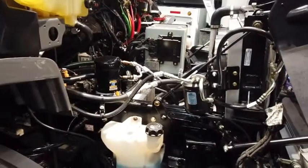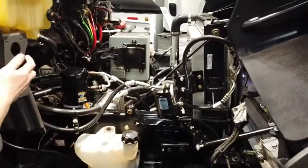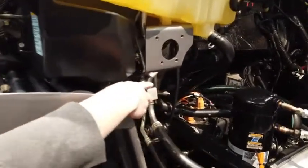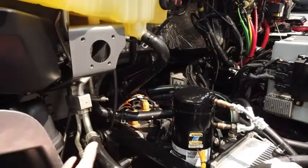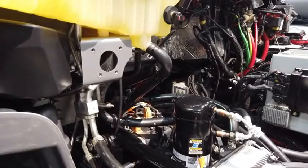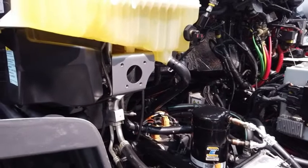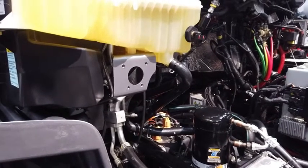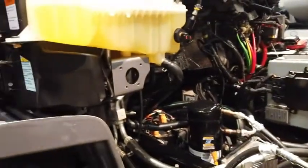It handles things like your AC unit when it kicks on and different things like that. To the back of the truck, that silver box with the fins — that's an example of an inverter. It operates kind of like a switch: DC power comes in from the battery pack, and this switch goes on and off depending on the software signal sent to the inverter, which converts it to AC power and also changes the voltage.